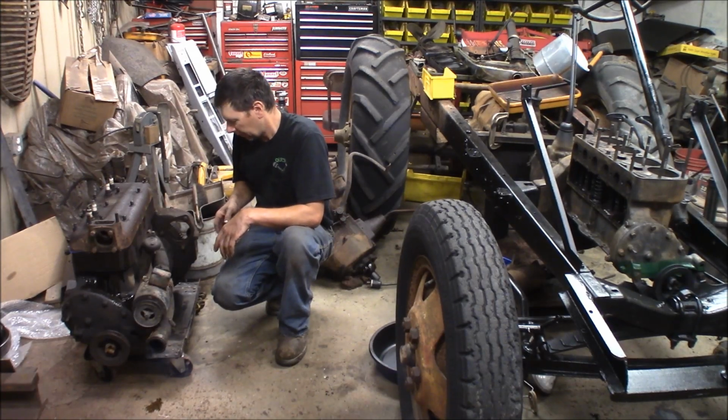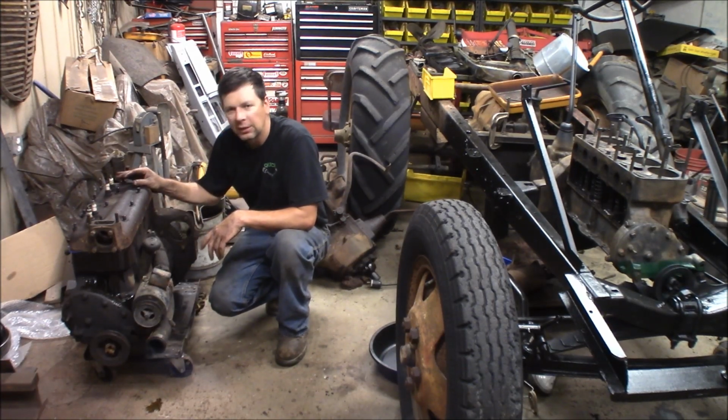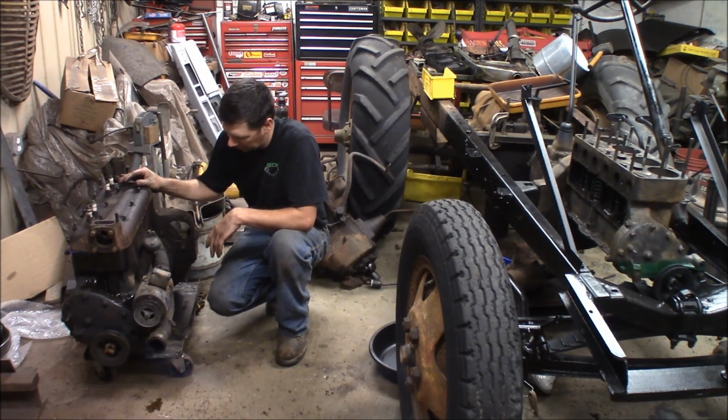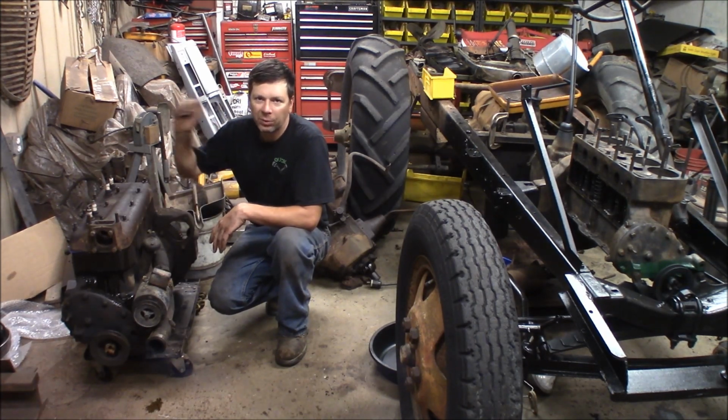And it's going to fight another day. Someday I'll take it apart and fix the timing gears, pull the valves out, have a valve job done. This would be a good candidate for a complete rebuild, you know, bore and all that stuff. But in the meantime, we'll just oil her up and we'll push it in the corner.